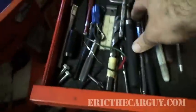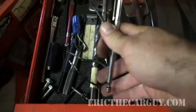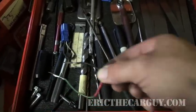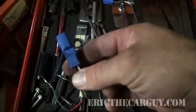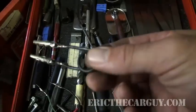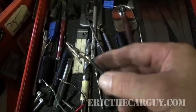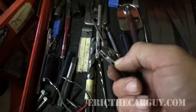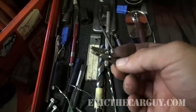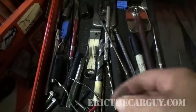This drawer has lots of neat things. I love my magnets — I love being able to not have to bend over and pick things up. I make lots of my tools. This is just a little short connector — this is all you need to get the check engine lights out of older Hondas and Acuras. One of my favorite tools that I made: this is actually for soldering wires together. You put the wires together, you've got the alligator clips to hold them in place. It's a piece of house wiring with a couple of alligator clips soldered to the outside of it.